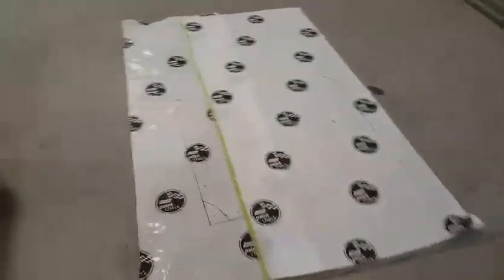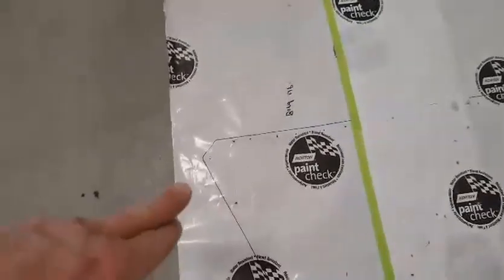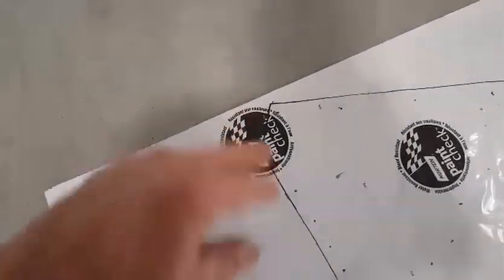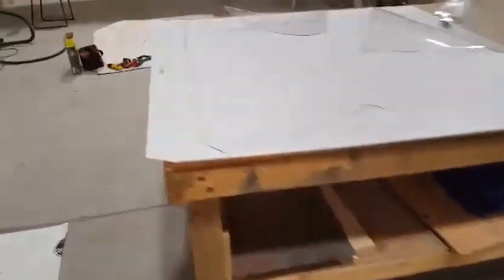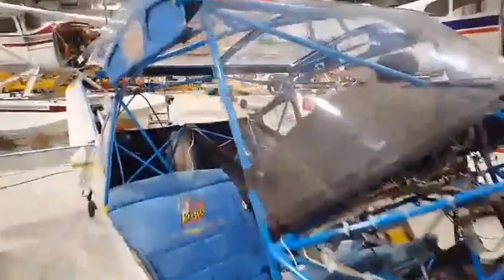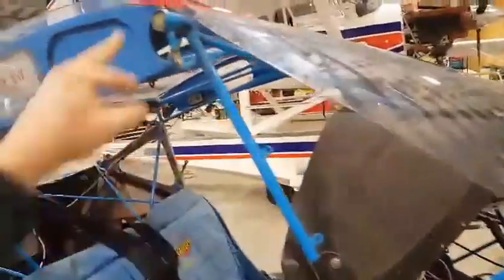This is the template I made — I fastened it on the table with paper underneath and traced it. You can see the bevel on this end and the bevel on that end are two completely different distances; this one's almost twice as long. So it's definitely custom. My friend Craig lent me his so I could compare — his is 3/32 inch, which is 90 thou. You can see the difference: his goes almost completely flat whereas mine won't even go flat. The one I'm putting on is quite a bit thicker and I'm worried it might break when I bend it, but I'll get some heat on it.